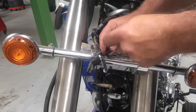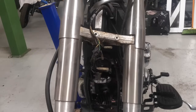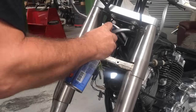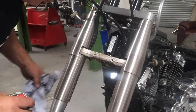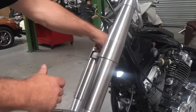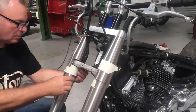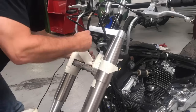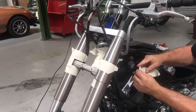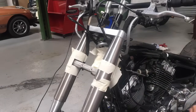So I moved on to the indicators. Took off the indicator bar and that bottom yoke looked a bit rusty and horrible, so I stripped it right back. The whole headlight bracket was off. Got some brake cleaner in there to get any grease or oil off. Took my time and cleaned up the wiring as well because I like those nice and clean. Scotch-brited it over, then masked it up. It really makes the bike look fresh when the bottom yoke is painted up.